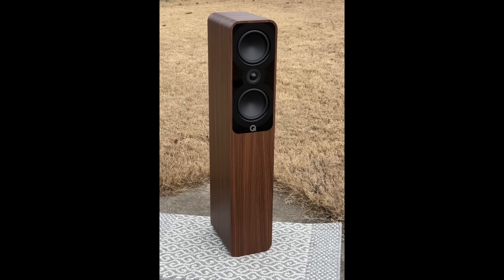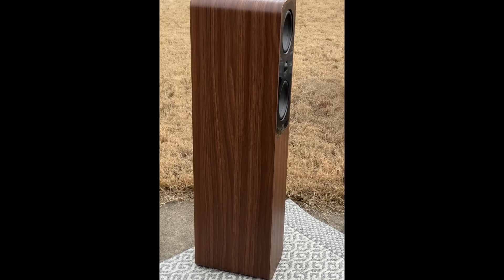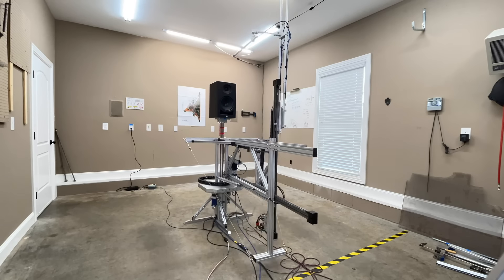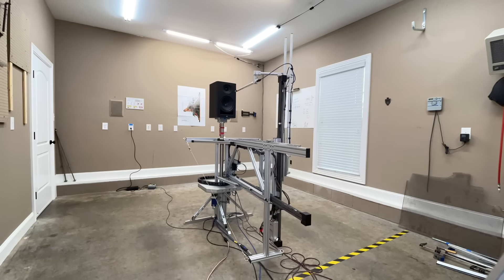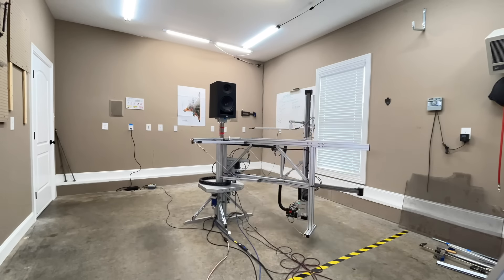These speakers retail for $1,500 per pair. They come with two five-inch midwoofers and a one-inch dome tweeter. They are ported, but you can seal the port. Sensitivity is rated at 91.5 decibels, and recommended amplifier power is 25 to 150 watts. They do have a magnetic grill, which I didn't use for my listening. The data is captured using my Klippel Near Field Scanner — a state-of-the-art robotic device that allows you to get anechoic data in a non-anechoic room. The data helps us understand not just the overall performance of the speaker, but how best to use it — specifically why the bass seems so low and why placing it closer to the wall helped.